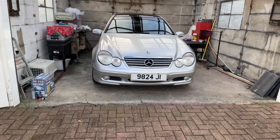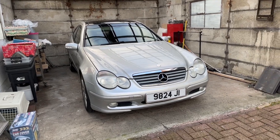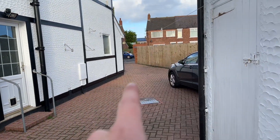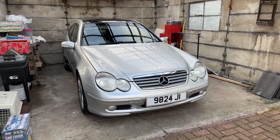I'm going to go through a few things that I would promote as a mechanic to do to a car when leaving it for storage. A lot of it's self-explanatory, but I know a lot of you guys maybe haven't had cars to store before, and something that may seem obvious to me may be quite of interest to you. So, first up: do not put the car in the garage wet. That's key rule number one. Do not put it in wet and do not drive on the roads when there's been salt spread or it's damp.